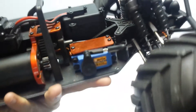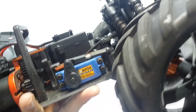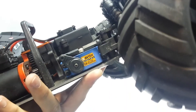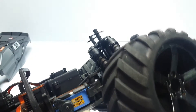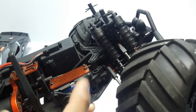As you can see, the car has been run. First big difference: the servo. I've changed it out for the Savox SW0230 MG — a waterproof metal-geared servo. It's not the fastest or the torquiest, but it's a definite improvement over stock. The truck turns a lot better, it's much more responsive, and the stock servo mounts straight onto it.